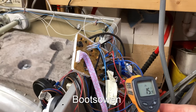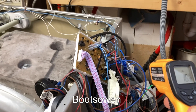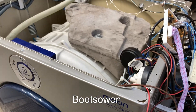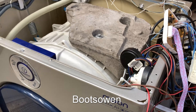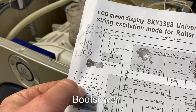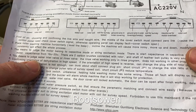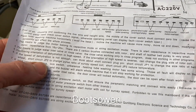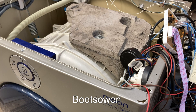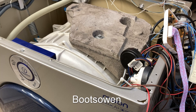At this point I thought it'd be a good idea to test the temperatures on the control board because the machine had been running for quite a while - spinning for maybe 10 minutes. I was worried that the heat sink on the motor controller was going to get too hot, but as you can see from those readings it really didn't. On the instructions it says: adjust dry speed - short circuit JP1 and JP2 if the speed of dehydration is not enough. Short circuit JP1 to change the size ratio of belt wheel, JP2 to change the pulse ratio of survey speed coil, and JP3 to reduce temperature. I think the pulse ratio of the tachometer might be wrong and that's why it's being a bit jittery. I'm guessing it's doing some kind of load distribution thing now.